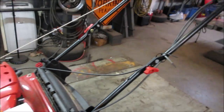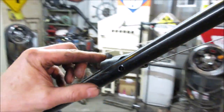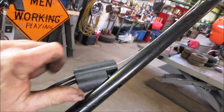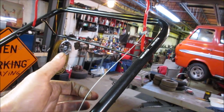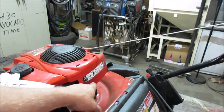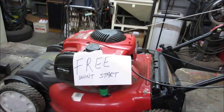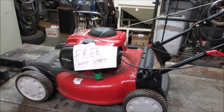Looking at the handlebars, something's kind of weird here — I don't know if it's supposed to be on that angle or not. That might be an issue right there. It looks like that should be popped over and on there. If that's the case, it's going to have a shutoff on this cable. If this cable doesn't get pulled far enough, there's a brake and an electrical circuit down on the engine that will not allow it to have spark, or will kill spark when you let go of it. So that might be what's going on.